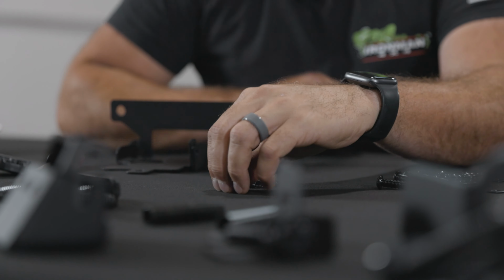Now before we get this unit installed here, we got one more thing we want to do. This little clip and this cable, this is your hood release. So we're going to pop this cable out, because if we don't, it's going to get in the way of this guy, our connector, and we don't want that rubbing on any wires. So drop this cable down. We will pop this out with a little clip removal tool. It's just like a little Christmas tree plug.